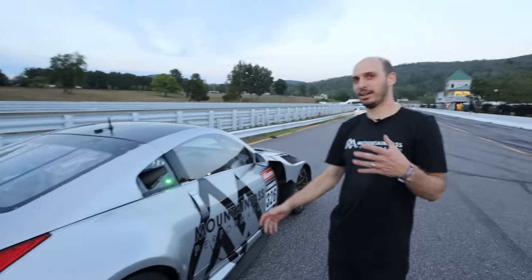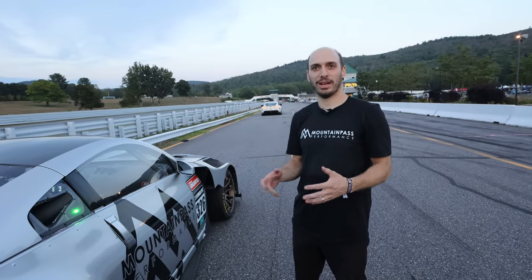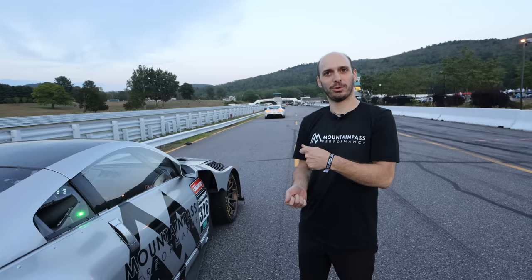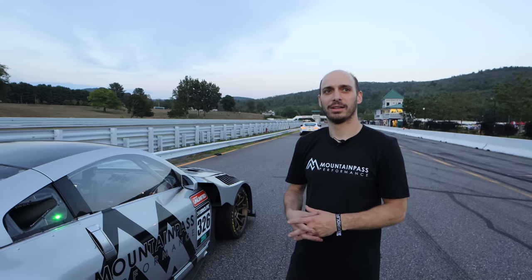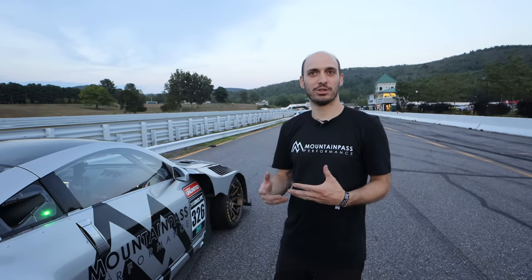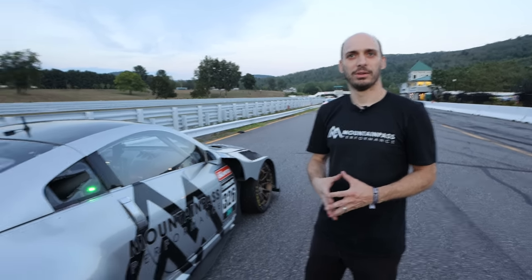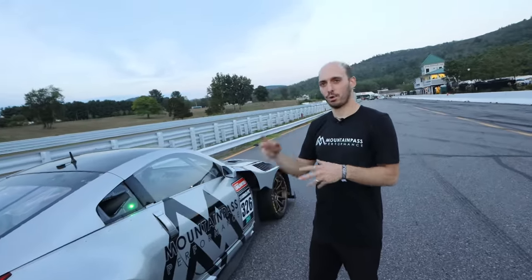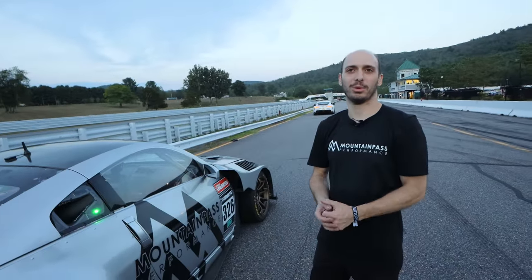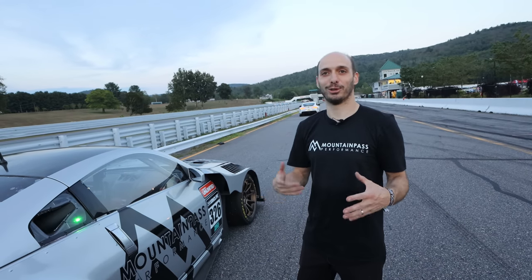You remember how I told you that front engine is bad for putting a bunch of power down? Well, usually having some more toe-in helps put power down, but it makes the car understeer a lot in the middle of the corner. So the concept was, can we use those actuators? You see them coming on Ferraris now. Porsches have them. This rear steer stuff. So I said, I bet we could buy an actuator and reverse engineer it and then fit it in the Z. So we did that like 4 weeks ago or so. And it's got a bunch of stuff in the ECU, so it works on steering angle and brake pressure and corner phase and knobs on the steering wheel, whatever you want, to independently move the rear wheels however you want. And we're still playing with it and learning what it should even do.